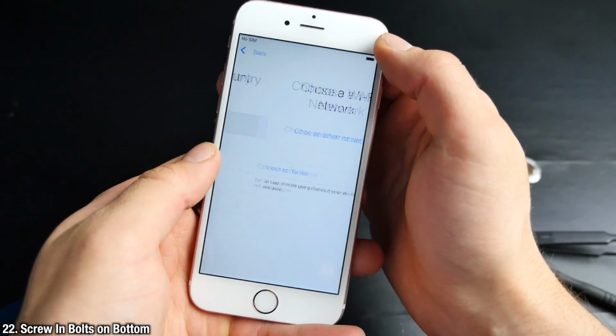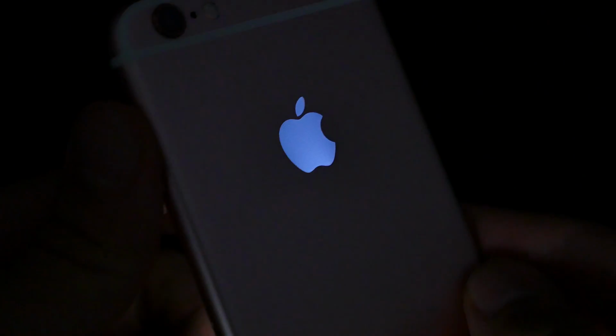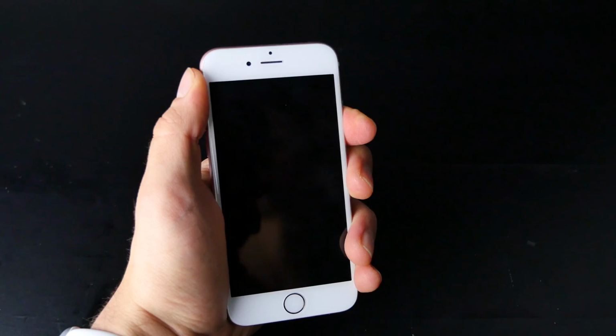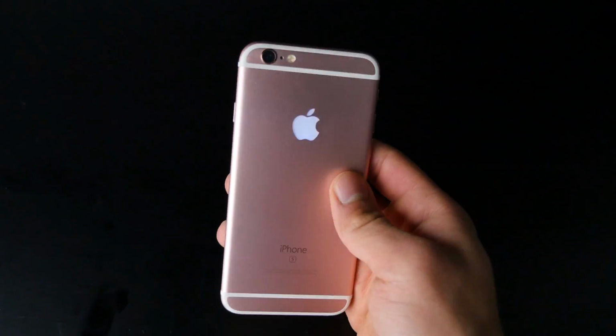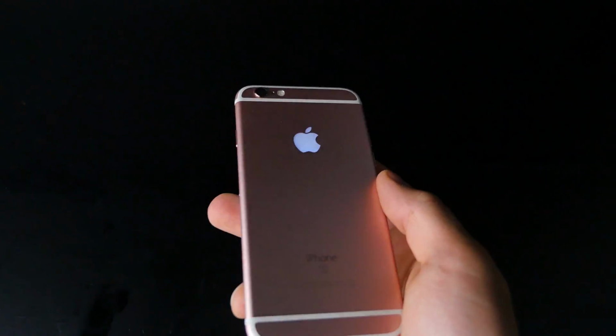So considering you followed all of the directions, you should have had no issues. Now, a couple things I noticed about this LED, basically like a mini review. After putting it in, it works intermittently. Sometimes it will turn on and work, which is about 80% of the time. Sometimes it just goes out and dims for no reason. It doesn't turn on for a while. It's intermittent, and it's not because of the connection. The connection is solid. I tested that part.